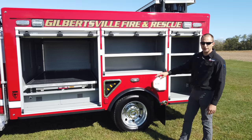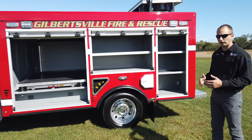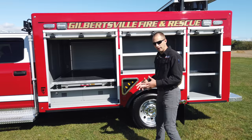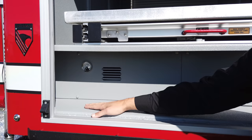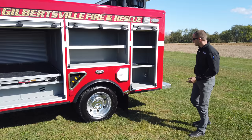This vehicle also has an airbag system on the back. Knowing what it's going to be used for — with the Trafcon board and loaded with cones on the tail end — the vehicle can handle it safely. However, you'll get some sag no matter what, so we put an airlift airbag system on it with an onboard compressor system, controlled right here. You can push the up button to put more air in or the down button to take air out. Right now we have about 20 pounds in it — you always want to run some poundage in the airbags, and you can easily increase or decrease depending on the load in the back.